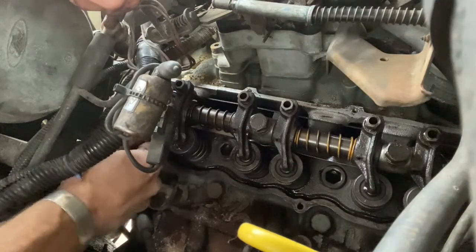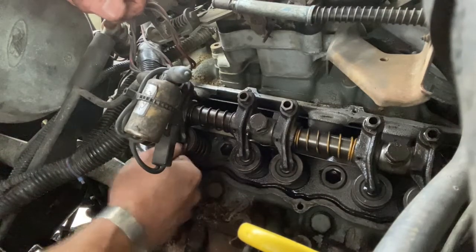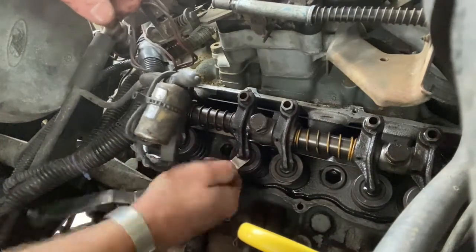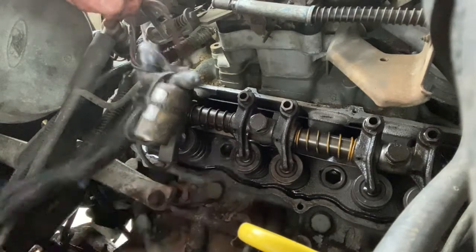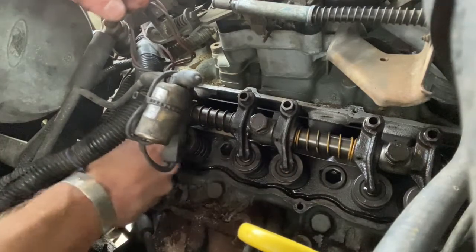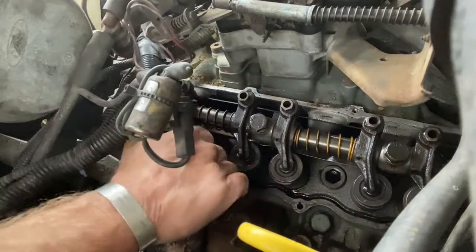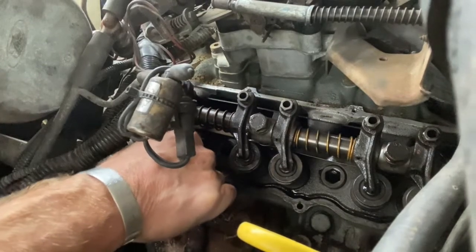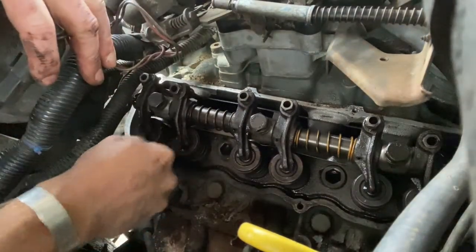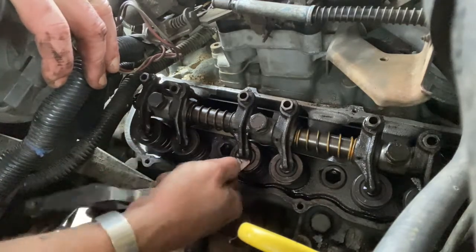We're going to go all four each time. That one I could tighten a hair. That one's starting to go down because I've lost all my lash - my exhaust valve is starting to open. That one is good. The intake valve on this one has started to come up but there's zero lash so that one's still going. I could snug that just a little bit more. Quarter turn and check it again. I might still do that one a little bit more. This one's down.